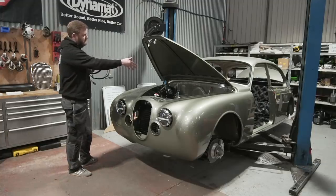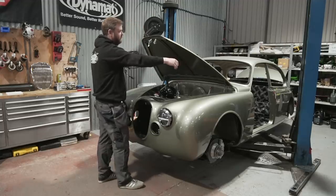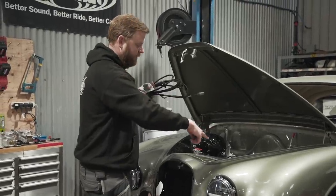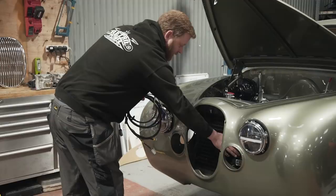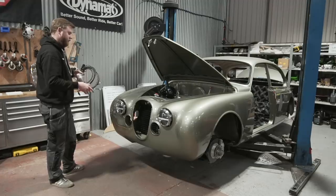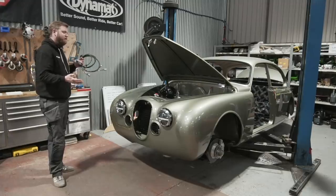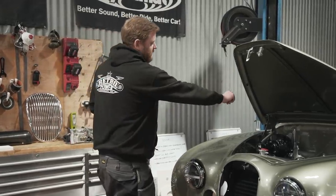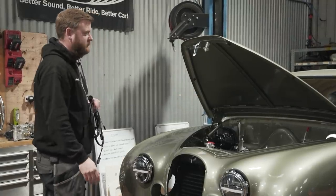The engine management loom will be to that same sealed specification. The front chassis loom comes through the footwell into the underwing area - during the metalwork phase we put threaded bosses underneath this wing and along the back of the inner wing, all the way down. So we'll be clipping this wiring along there to feed the lights, air-con dryer, horn, and fan. We planned all that out at the metalwork stage so at this stage we're not drilling any holes at all - it's literally just clipping into place. Same with the engine management loom, using those clips under the throttle bodies to securely retain the wiring in a fairly hidden position, so there's not really going to be much visible wiring in the engine bay at all.